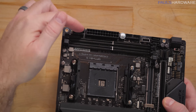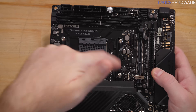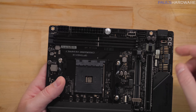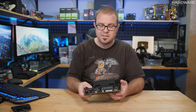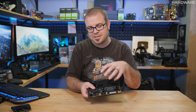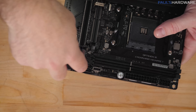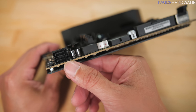They've got both the 24-pin and 8-pin power connectors right next to each other on the same edge of the board, so routing cables to those is going to look very clean and tidy and will ease cable management. There's also a USB 3.0 port next to a USB 3.1 Gen 2 front panel connector. There are four SATA ports — two vertical and two horizontal.